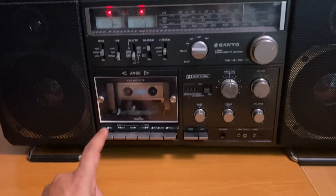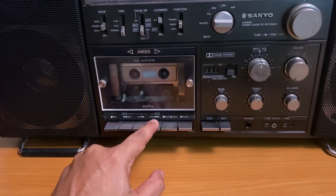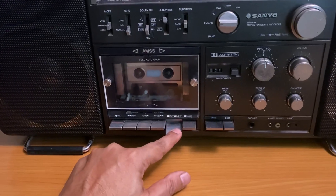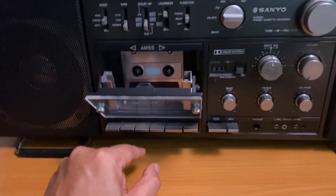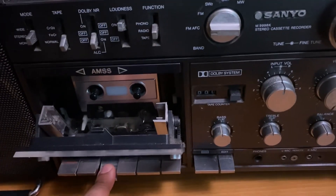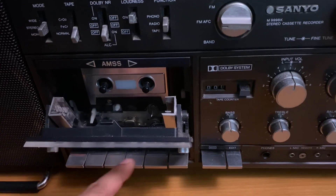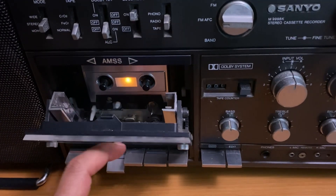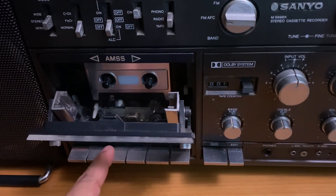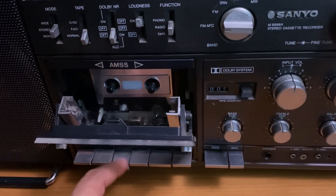The other problem is the tape deck as well. While it looks better, there seems to be a fundamental problem with all these units - if I press play, you'll see the head doesn't actually go up. It lights up, but when I press play that head should go up. For some reason it's not, but I can feel resistance so it's good mechanically.